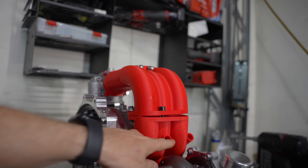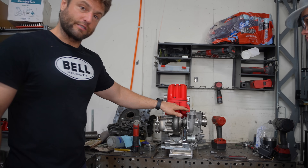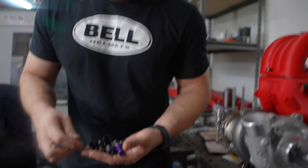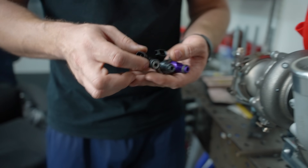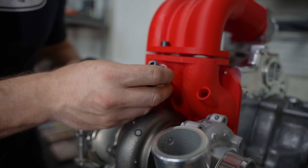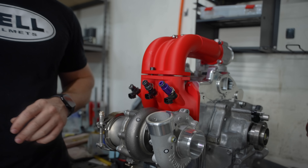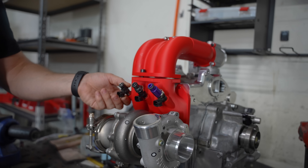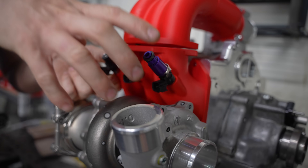I'm going to grab some fuel injectors for testing. This is where the position of the injectors are. I can take that rail stock and just cut those holes into it — boom, we've got a little baby fuel rail. We've got really three choices. At the end of the day, less is more. This is the base standard height of all these injectors, but these also have extensions — it would sit like that. That shows you the different heights we could have the fuel rail out if there was a reason to. Ideally I'd want less, and quite frankly, the shorter it is, the more we can get to things underneath it.